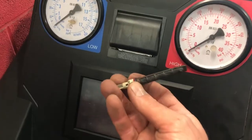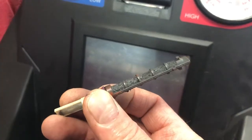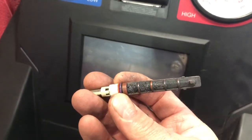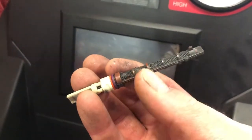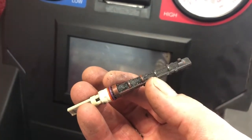It's kind of like a funnel inside, and if you look at this you can see all the debris on there — it's just full of metal. The compressor actually came apart and passed all the metal into the system. Interestingly enough, this orifice tube is actually blown out inside. This debris really didn't cause any problems with the air conditioning system, probably restricted Freon flow just a little bit.